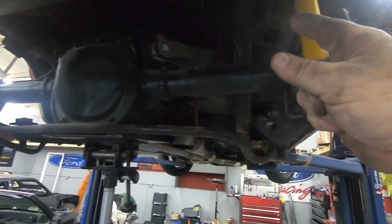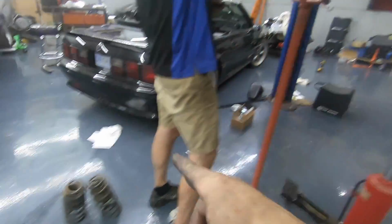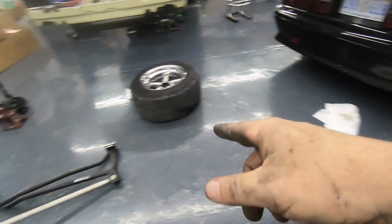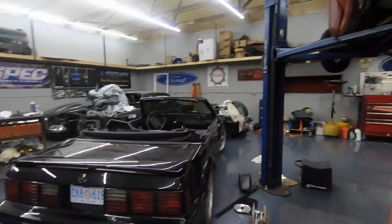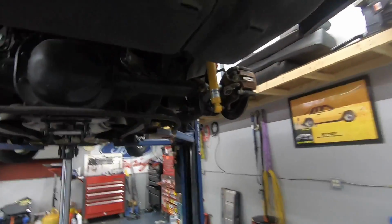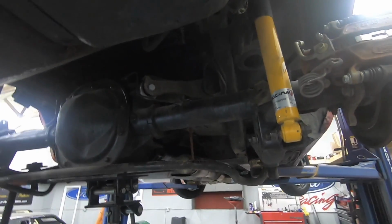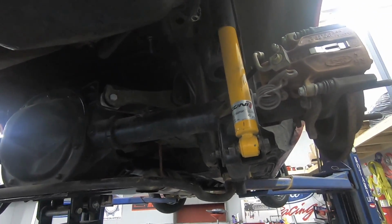Exactly. For your entertainment purposes only, I'm taking off the best suspension on the planet. Basically what we're doing is we're going to put stock cut springs in place of my Maximum Motorsport springs. And of course we're doing the double adjustable uppers, and we took the panhard bar off. And again, guys, I'm a man of my word. We are going to run the number. I don't know exactly how yet, but this is a step in the right direction.